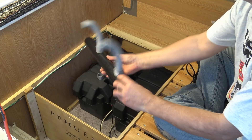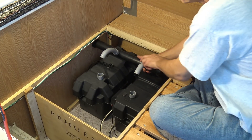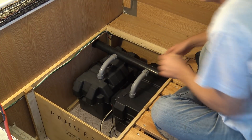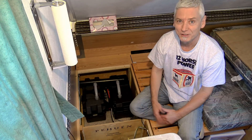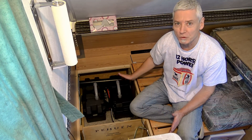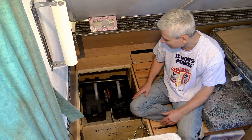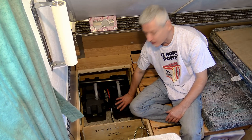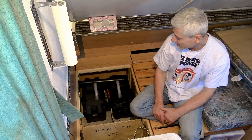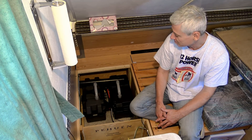So that's basically it — all glued in place. You just put it in the vent, push those down into position, and you're good. Batteries are now warm and toasty inside the trailer. No more worrying about dust, heat, cold, and all the other nasties on the tongue. You've got them vented — path of least resistance. Any vapors in the boxes go right out through these hoses to the outside. Very easy — a couple of hours, a few dollars, easy plumbing supplies. I think it's a winner.